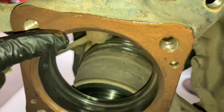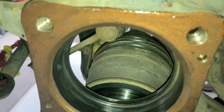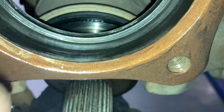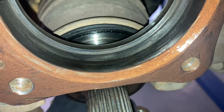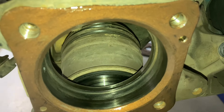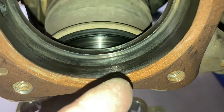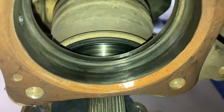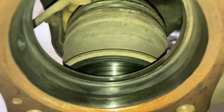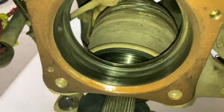First port of call: this flat surface here covered in grease all the way around is what's going to stop the water first, because when the hub presses onto it, it's going to ooze out the side so things can't get into the flat surface anymore. And then if it makes its way in, the next surface we want covered is where the taper is — to stop any rust and corrosion and to help that O-ring seal. Now I want to paint this inside flat surface — about 15mm deep — but really lightly. We've got an ABS sensor there, we don't want to be making a mess in here. Just enough to cover it so it's got a super thin coating, so if any water does get in there, it prevents corrosion and things getting stuck.